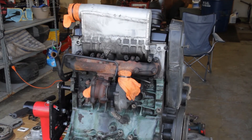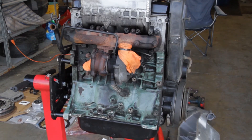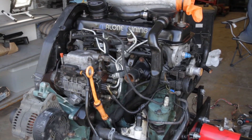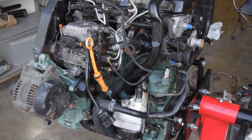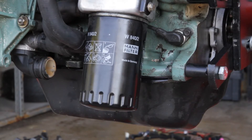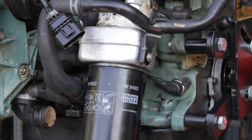So today we are focusing on mostly the side of the engine. We're going to be taking off the exhaust and intake manifold and putting on the new ones. We realize the studs came out with this one, so we're going to actually do this at a later date. But we did the oil pan on the bottom also. The only thing we're going to do on the other side is the oil cooler — other than that, that actually ended up not working because of a different issue. In the next bit, we are going to show us taking off the oil cooler and then we're probably going to do the oil pan right after. So this is not really that difficult — honestly, it's pretty easy to follow along. We do run into a few issues which we are going to fix — it's basically just us missing one part. So we just have a standard oil and oil filter right here, and what you're looking at right there is going to be your standard oil cooler, that is going to be replaced with the bigger oil cooler.